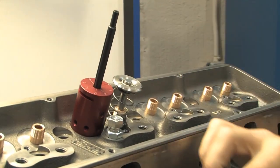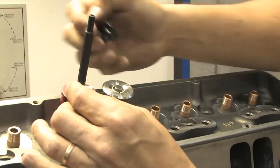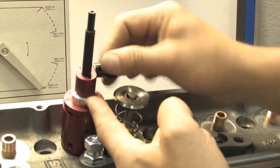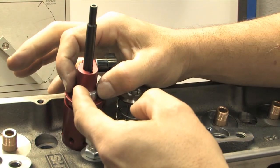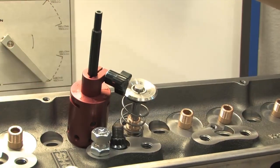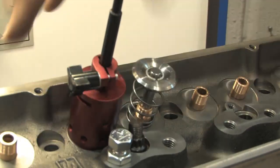To use it, slide the valve up into the head so that it's up against the seat. Put a spacer in place against the collar — this, by the way, is a 300 thousandths inch thick spacer. Then drop the locking collar on until it presses against the spacer. Line it up so you know where the hole in the valve is and tighten it down. Now remove the spacer and press the valve down until the locking collar bottoms out against the positioning collar, and you know the PD valve is 300 thousandths off the valve seat.